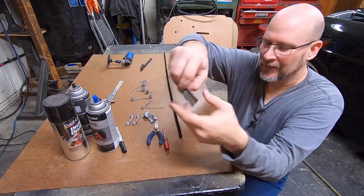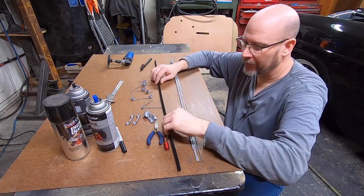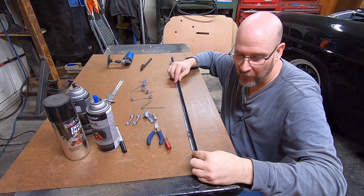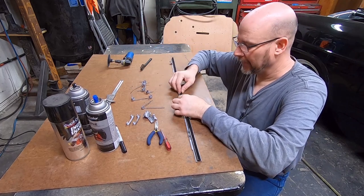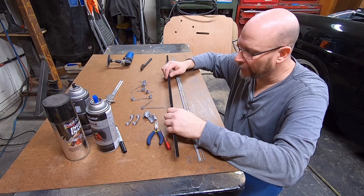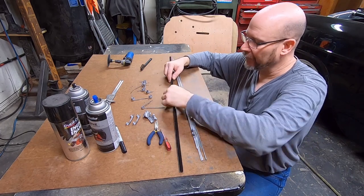It's got to lay on top of this piece here — this bracket — and the top of the rivet deals there, so that is going to make it stick up anyway. This is deeper down because it has a channel right there, so the felt strip top edge is going to make it set in there at an angle. That's just the way it is — that's really the only way the average person at home restoring these flippers can get the felt strips to set in there. You don't need to grind all this — you can just glue it right at the top of the bead if you want. It will work just fine, but it doesn't take that long to grind it down and stuff it up in there.